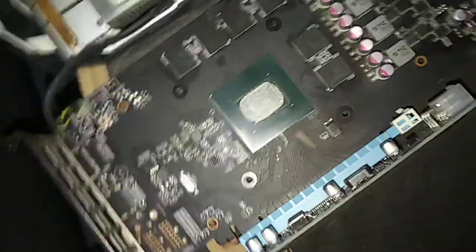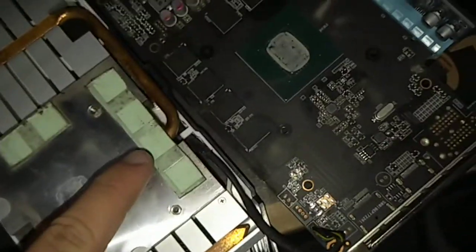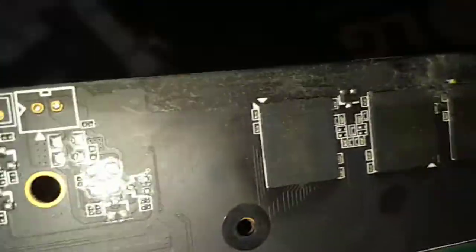As you can see, this part is the GPU — this black PCB right over here. You can also see that there are thermal pads that are meant for the VRMs and for other parts of the GPU, while there are remnants of thermal compound for the GPU itself. The GPU is fine — we don't need anything from here. All we have to do is unplug the power from the fan so that way it is completely separate. Just so you're aware, this is pretty dirty — I'm probably going to clean it off with 92% isopropyl alcohol.